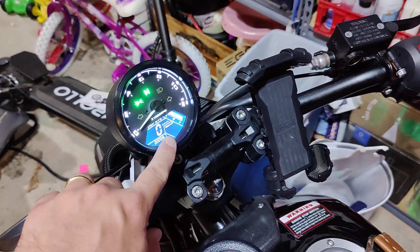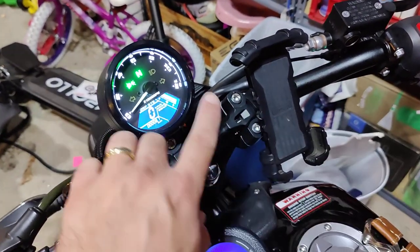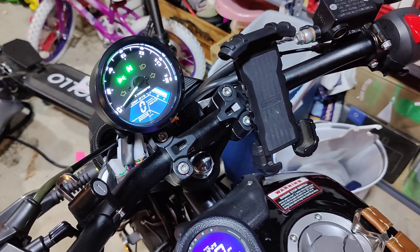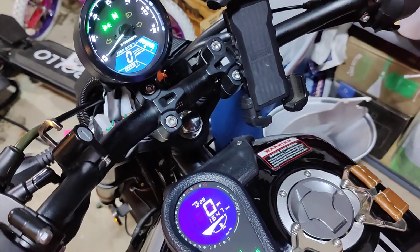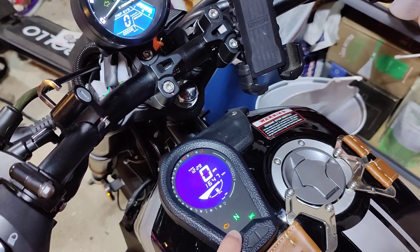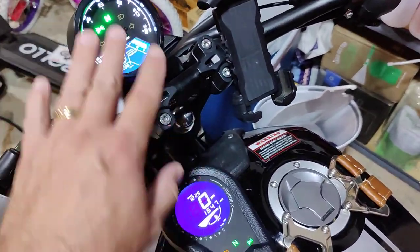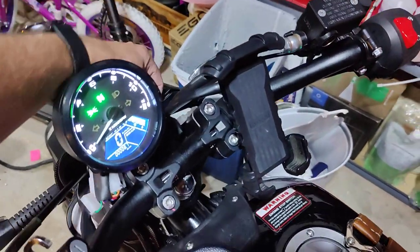It's still stuck to kilometers per hour — I'm not sure how to change it. But everything is accurate: it reads the speed properly, the fuel gauge properly — the bike is full. It reads all the indicators. It doesn't have a fault indicator or anything like that, which the stock one would have — like engine lights and being able to tell if your EFI system or EVAP system is not working right, you'd see it down there. That's why I just tapped into both and they run in parallel just fine together. I highly recommend that kind of mod if you decide to do it.